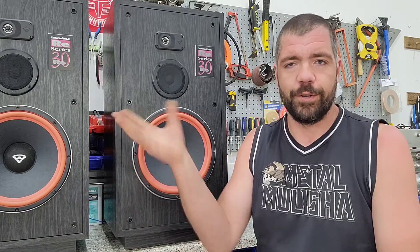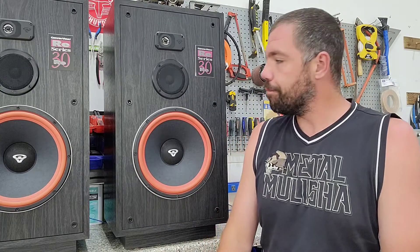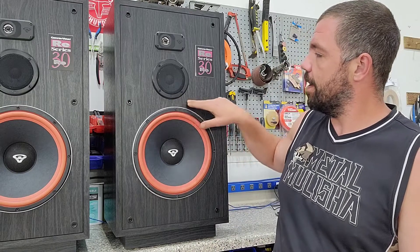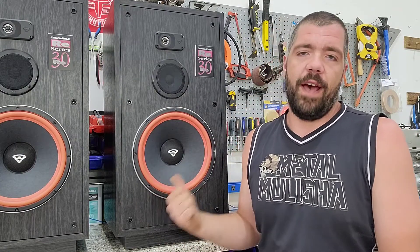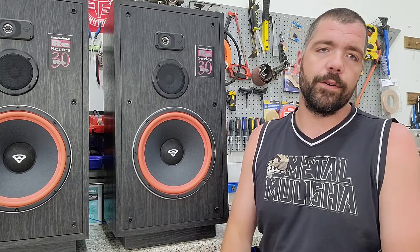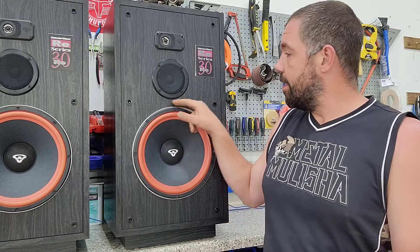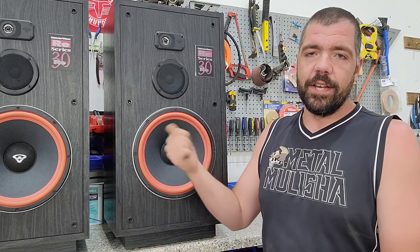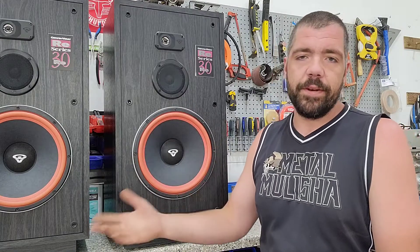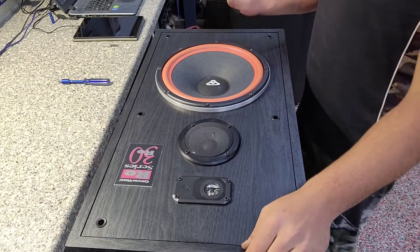Just as I thought, it is just this one. The other things you heard rattling were just my tools and stuff in the shop. This is the culprit — right here around the mid-range, just above the woofer — and it goes away when you push on it. I haven't had these apart yet, but I'm going to assume they are going to be similar construction to the VS120. They usually run a brace straight across the back, and sometimes that glue gives out after years and all the vibration these speakers put out.